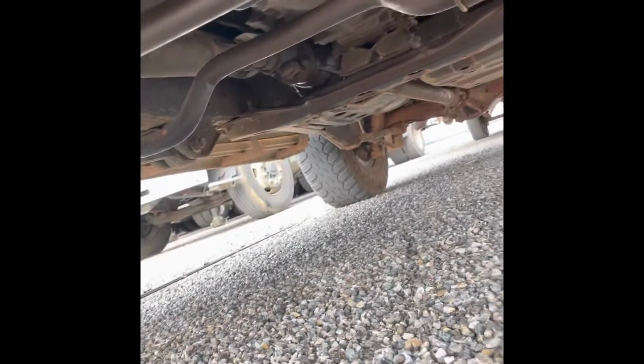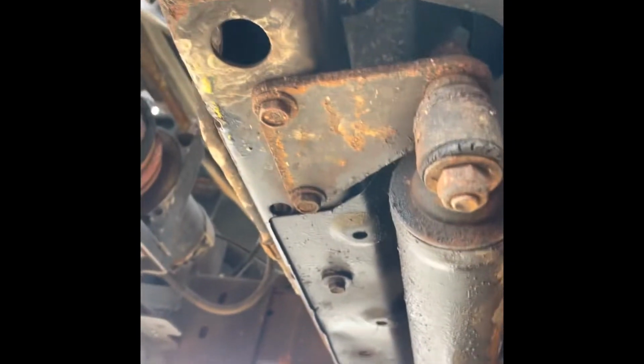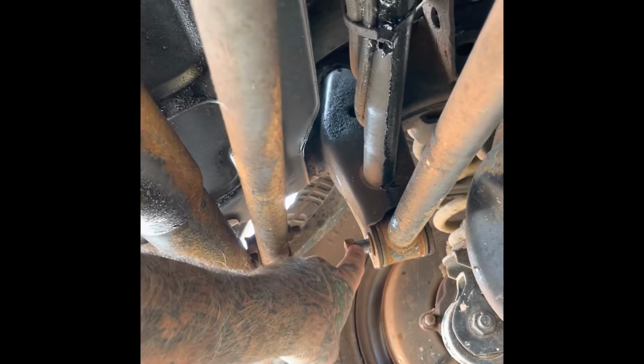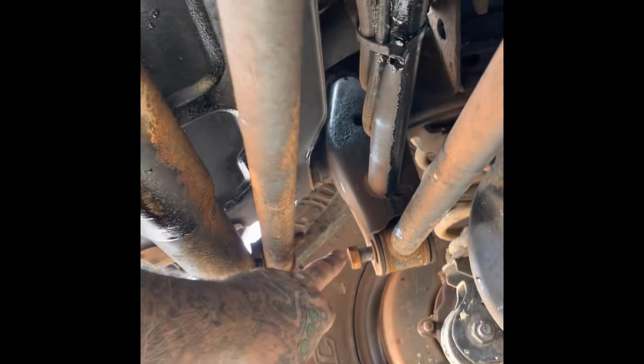But everything else under here is looking really good. Like I said, I've just fixed a little fuel leak. We went from 300 Ks per tank. This thing's got 2 tanks in it. We went from 300 Ks per tank, so close to 600 Ks all up, to about 240 in one. So we've lost 60 litres, and I've just found the leak. So all sorted there, but that could have been very, very dangerous. And the fuel leak obviously happened for a reason, for me to find that bad boy there, because that could have killed someone quite easy.